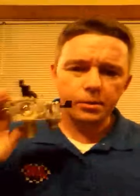Because if you've got a big valve in here, like a big 30 or 28, and it's really big ported, and you've got this little stock appearing carburetor on it, it may be bored out to 650, 675, 680, but still you've got this humongous valve and this really big port, and it's going to make the fuel signal in this carburetor go crazy. You may have a ton of fuel signal at the bottom and completely lose it at the top, or vice versa. It does some crazy stuff. You just really can't keep the fuel signal and the fuel curve and the carburetor set right.